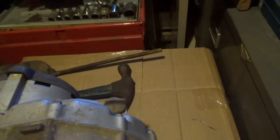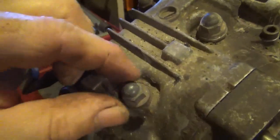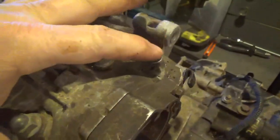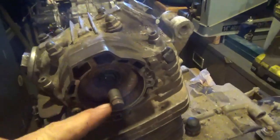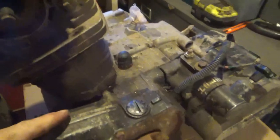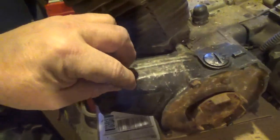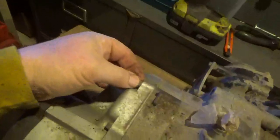I'd really like to save this engine. Given that it's seized, let's start up top. Starting right on top here, it doesn't look like any of these bolts have been out — it doesn't look like a mix and match. They did steal a couple of pieces out of here but it really appears to be in nice shape. These two bolts are missing but they go to the starter; the rest of these don't look like they were out either. That's a really good sign.